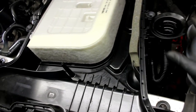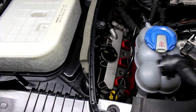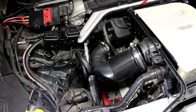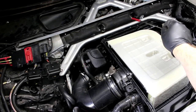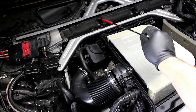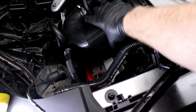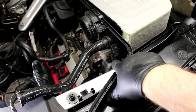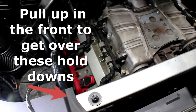The oil fill extender is really easy to take off. There's a tab here — push the tab in and it just pulls right out. This is your intake. The whole air box here, on the back, has two recessed points that mount on two tabs. This part of the air box pushes on those tabs. Getting the intake part off requires a flathead screwdriver — there are two band clamps holding it on. Remember there is a vacuum line coming into the bottom of the solenoid that you'll need to pull off, then disconnect the electrical connection.